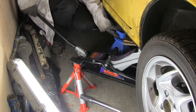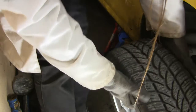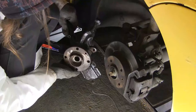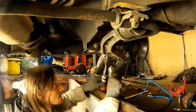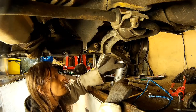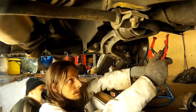First we're jacking up the car and removing the wheel. Then we need to unscrew the axle nut, which requires some serious force. The best and simplest way to keep the axle from rotating is to hit hard on the brakes. The order of next actions may differ depending on tools and technique you use. Here we're using different pullers and of course tons of penetrating oil.